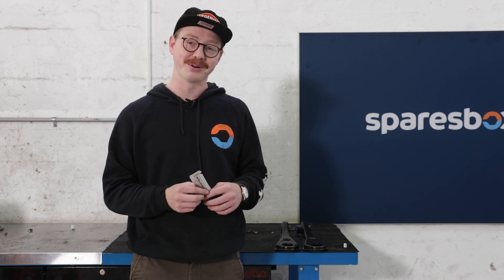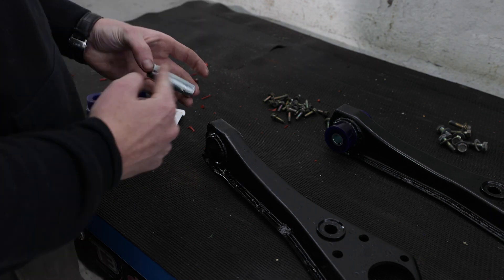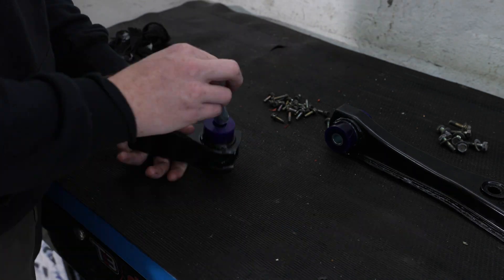Now, if there's one thing you know about me, it's that I don't like to get my hands dirty. Our videographer Sandy remembered to do one half of his job this time, which was roll the audio, so I'm going to pass over to him. Super Pro Bushes are really good and come with an installation grease pack. Make sure you put it on all the moving parts of the bushings, otherwise they will tear through in the future. So push your old bushing out, grease up your new one, and slide it on in, and there you have a nice new arm.